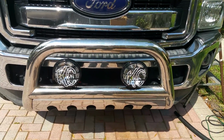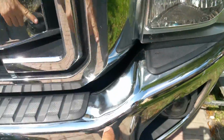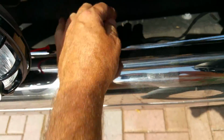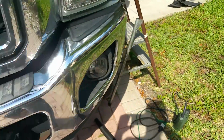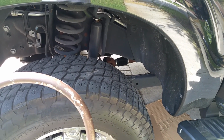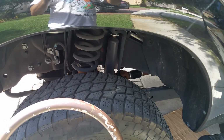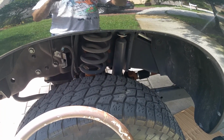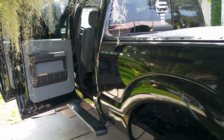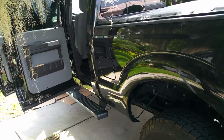And this is what the lights look like after installed. Again, all you want to do is the wires actually just try to go through here. Make sure, of course, as you're putting the wiring through there, coming out to the lights, I haven't used any ties or anything yet, but you want to make sure that it's not going to be rubbing against something on the vehicle that actually moves, and it's eventually going to damage your wires. And of course also not going by any pipe or the radiator or anything that gets really hot that may damage the wiring. So again, hopefully this helps somebody out, whether you were wanting to install the actual fog lights, or you were installing a radio, an amplifier, or any other thing that you just needed to get the wires through.